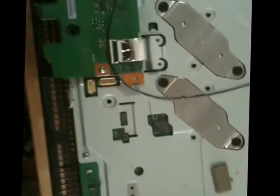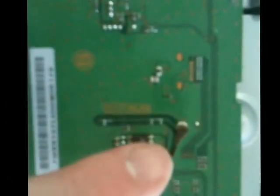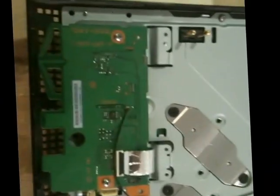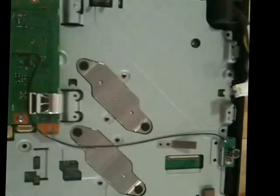Now we've got the guts here. Let's take the network cards off next — this is probably one of the most fragile parts of the whole thing, so this is worth taking a little bit of care with. I'm going to take these two screws off, disconnect that ribbon, and take that screw off. This long cord connects the WiFi and the Bluetooth receiver for the controllers — that needs to stay connected. It's just a little plug-in right there, you can probably reconnect it if it comes off. But on this side it's just a solder bridge, and that's pretty fragile, so this is a careful operation.